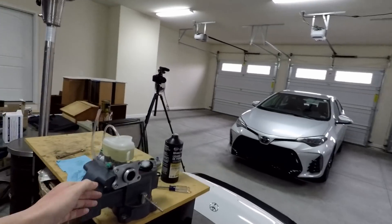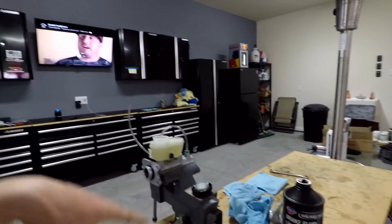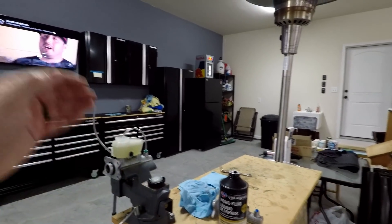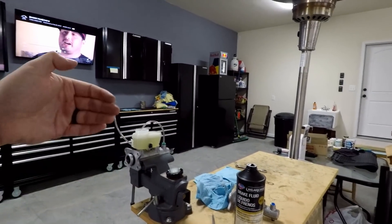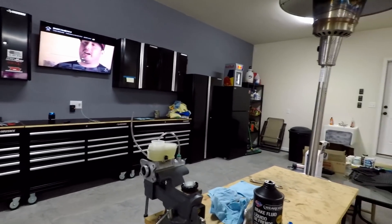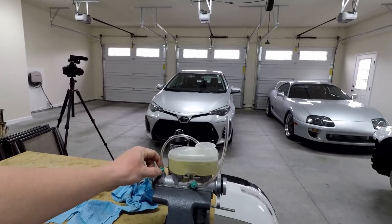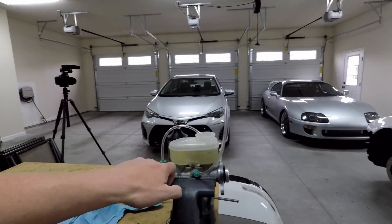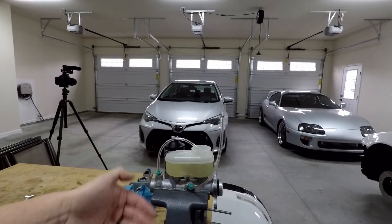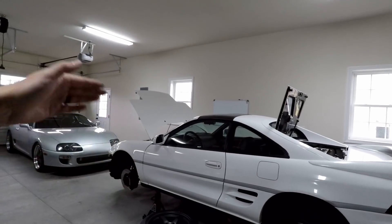So I have the brake master cylinder up here now. I went ahead and put DOT 4 fluid in it. Toyota recommends DOT 3 or above, and the car originally had DOT 3, but once you go up to DOT 4 or DOT 5 you cannot go back, so I'll be using DOT 4 throughout the entire car. What I'm doing right now is bench bleeding it. This new master cylinder actually came with its own little kit — fittings and lines — and you put the lines into the top and literally burp the system. There's air in the cylinder and we're purging it ahead of time so we don't force that air through the entire brake system in the car.